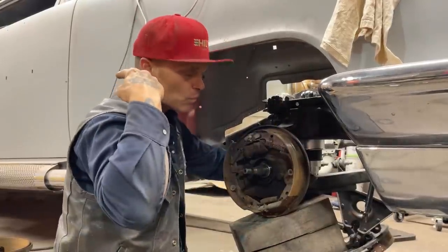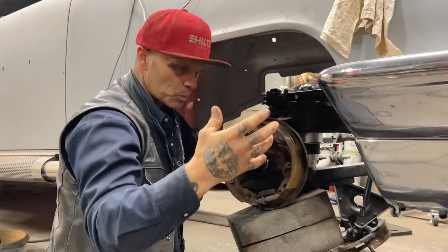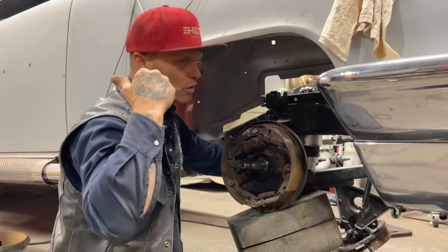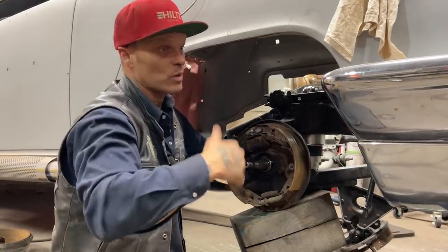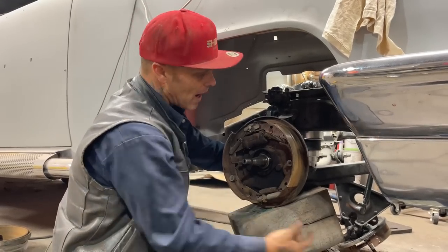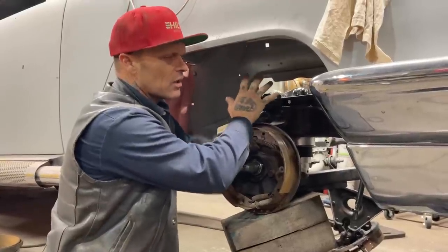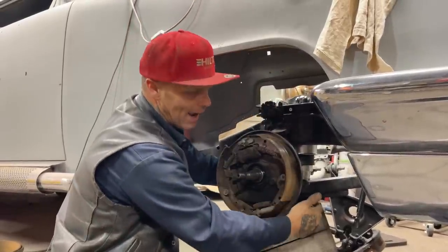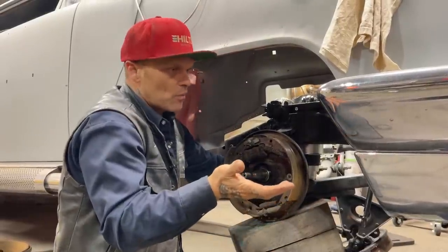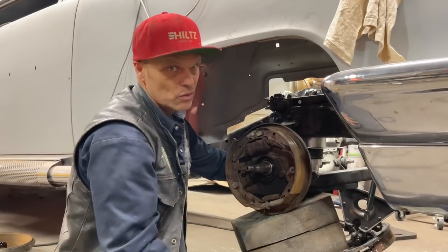On the back, when we first put it on, it sat like a four-wheel drive, and it would not come down far enough. We couldn't do the ones in the back backwards because we were trying to keep the rear end in place. But as I'm doing this one, I can jack the front lower control arm up and make it as if the car is sitting on the ground and then make the bracket. That way, when I put the air to it, we're going to have ride. And we're also going to know that it'll go to the ground.